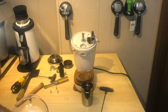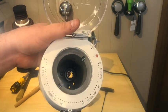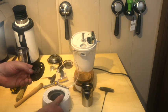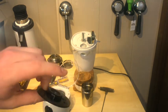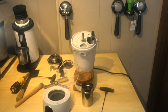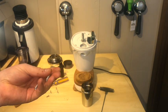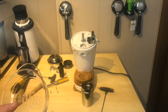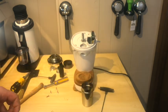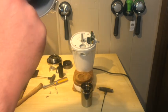That just lifts off. There's the inside of the grinder chamber — your burrs fit down in there and your motor shaft fits up through the top. There's a plate with a ball bearing in it, which prevents grounds from getting down into the motor. There are a couple of springs that just fall out. Super Jollies and the Turns do this. The Turn used little pieces of rubber or soft plastic to keep these springs in. Little springs like this kind of drive me nuts, but it's part of most grinders.